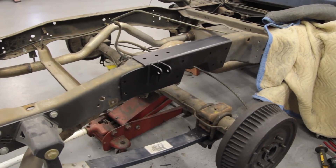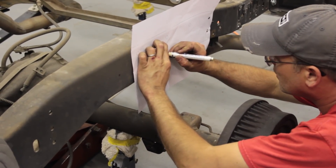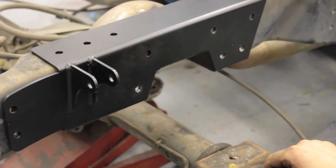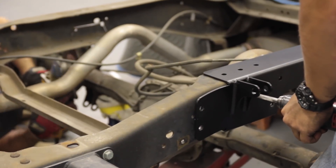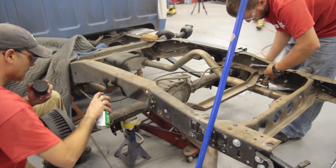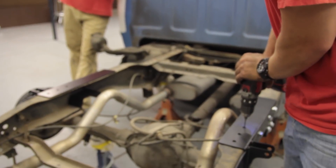There's hardware for that and I'll start bolting it on. John and I are going to trade places now — he's going to put all the bolts in and drill the holes for the C-notch on the passenger side, and I'm going to go to the driver's side and start doing some cutting. It's always a good idea to put the bolts in on the side of the C-notch first to make sure it's fully tight against the frame before drilling the holes on top. There are a lot of holes to drill, but all those bolts are what makes it so strong.